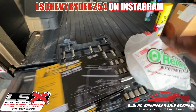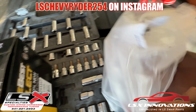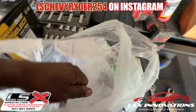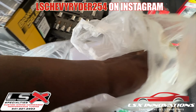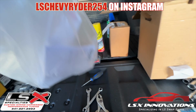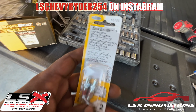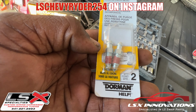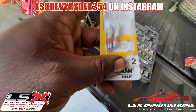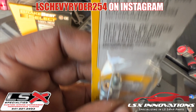So, other video, I showed y'all, but I got the bleeders for the front. I was trying to see if I still had the bag or the package so I could show y'all the part number again. I guess I ain't got it no more. You got to go back and watch the other video because I can't find the paper. So this is for the rear. These are M8 by 1.25, overall length is 28 millimeters. I don't know if these are longer than the other ones, but they are speed bleeders with the built-in check valve.